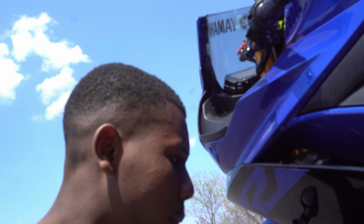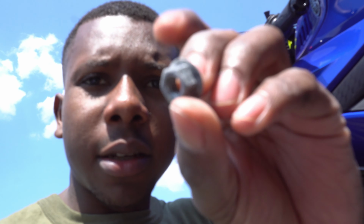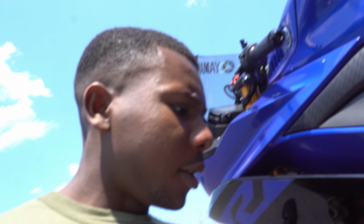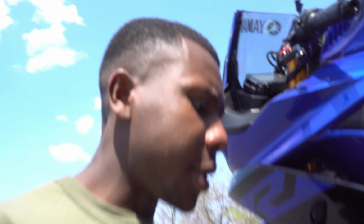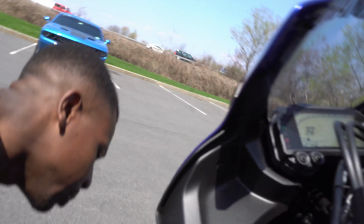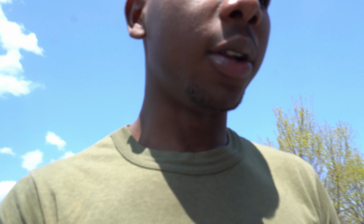All right, so I got all four bolts off. They weren't corroded or anything. I thought they might be, but they're just kinda discolored, and they came off really simply. You could definitely do that with a hand tool if your stuff's not corroded. If it is a little bit corroded, just throw a little bit of PB Blaster or WD-40 on it, let it soak, hit it a little bit, and then just keep going. Take your time, because you don't wanna snap the stud or anything like that and make the stay a lot longer than it has to be.